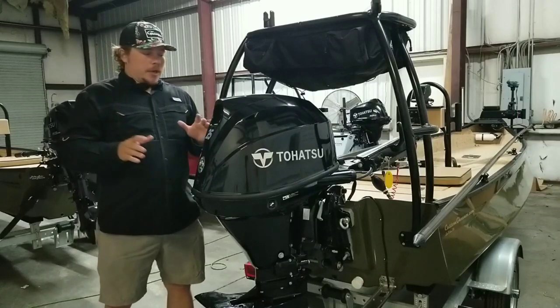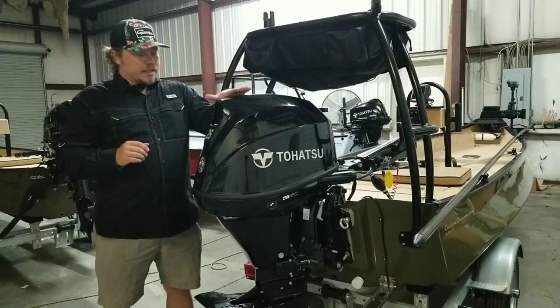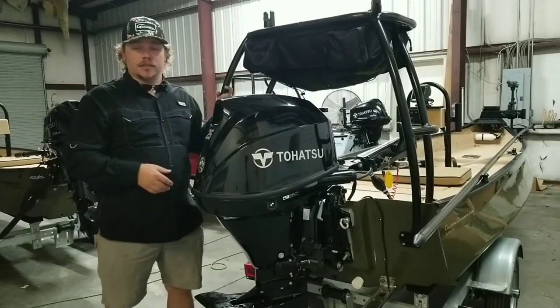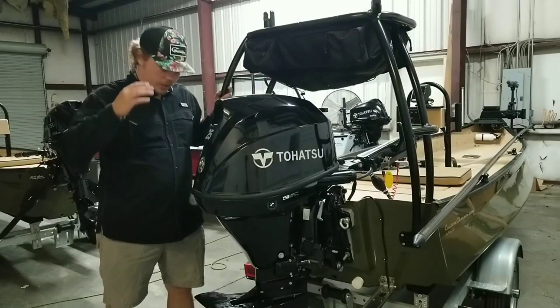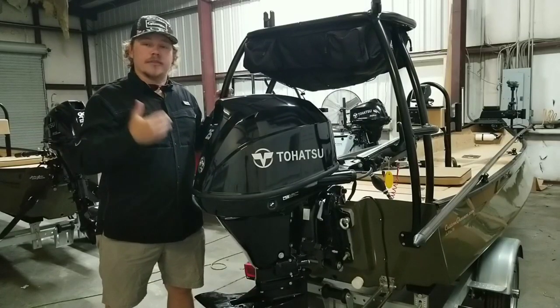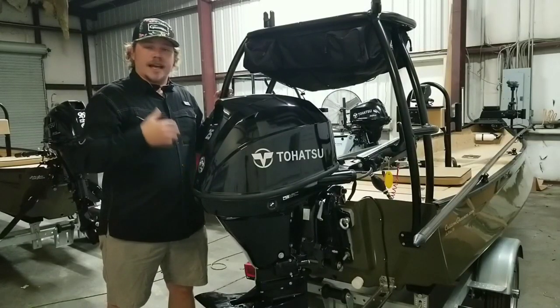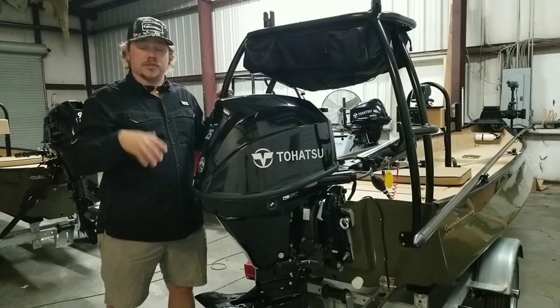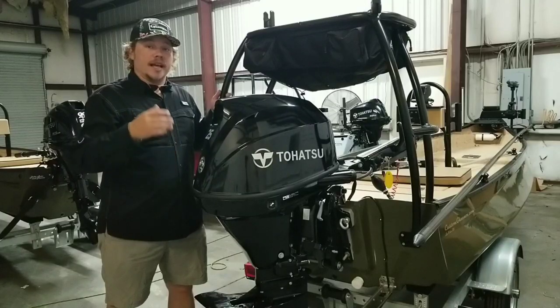Okay guys, so the big purpose for a hydrofoil is we're trying to make this more efficient at pushing this. Now this is a custom Ginu LT25, and the reason we put this hydrofoil on this boat is this one does not have a forward battery, and the gas tank is in the rear. So all the weight in this boat is at the back of the boat. So to make it run efficiently, we had to help it.